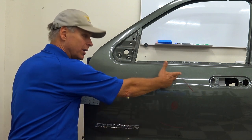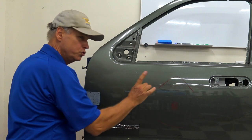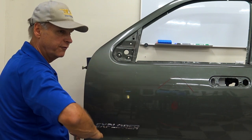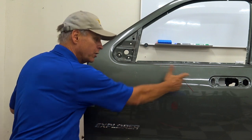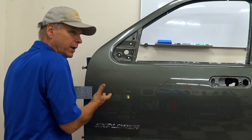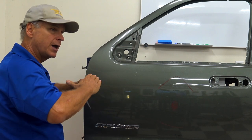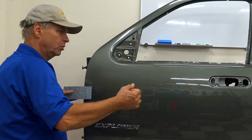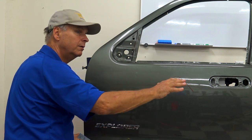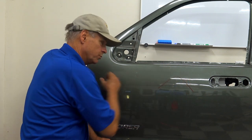At 90 degrees, usually, all you gotta do is put tension on and that crown rolls very easily. But sometimes even on a 90 degree crown, and like I said, definitely on 80, 70, and 60, what'll happen is you'll start pulling, it'll initially start to move and it stops. And you go, put a little more pressure on it. It doesn't want to move. That's the crown saying, I need help. I really do need help. That's when you stop immediately.